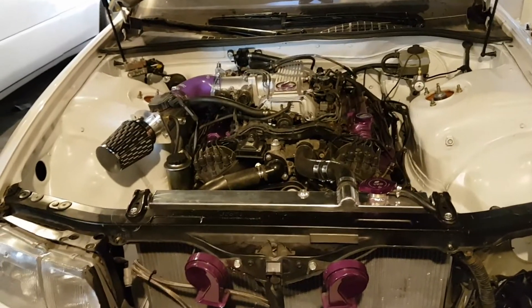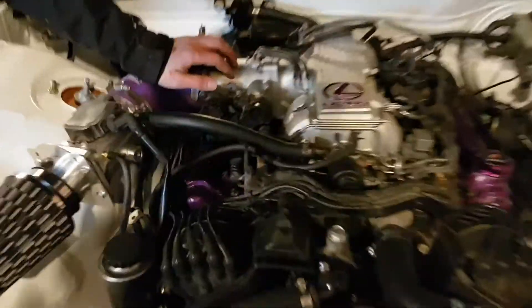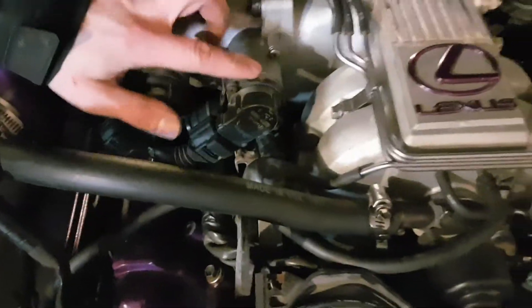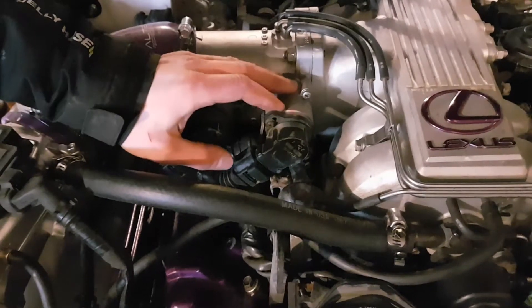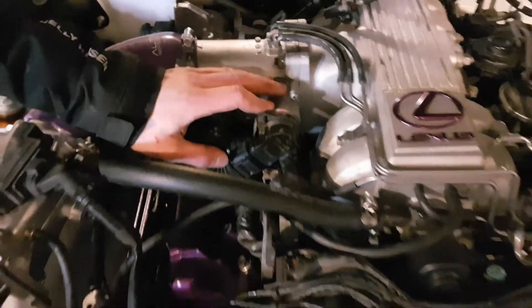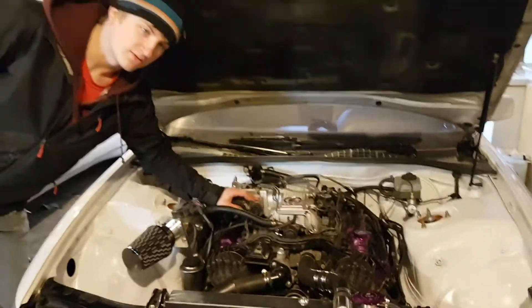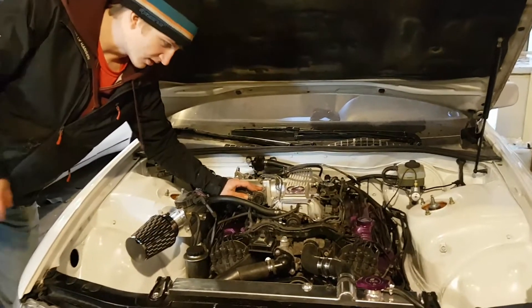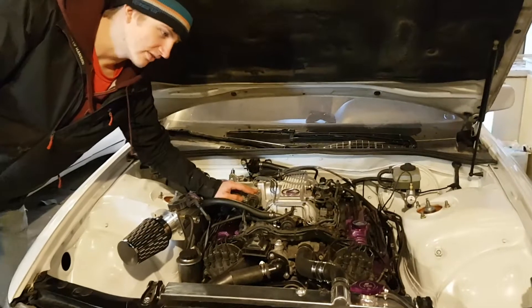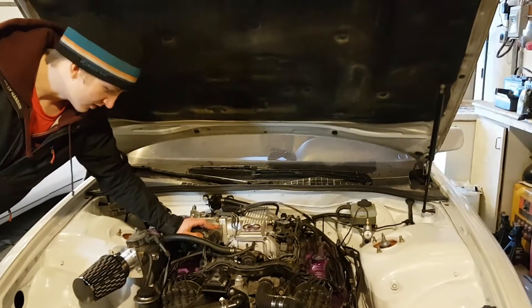I think we've finally resolved it, though I'm not sure. Once it got warm, it leveled out. We adjusted the throttle position sensor. What was also happening was it would idle and then without touching the throttle, it would rev up to 3000–4000 RPM and then almost die, then catch itself again — nonstop like that. I adjusted the throttle position sensor and it levels out a little bit. We'll still do it properly with a voltmeter, but we got it idling good.